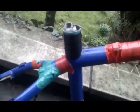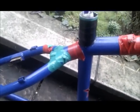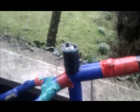You can also see there's quite a lot of tape on the frame — this is where I've plugged up holes. I've been using Blu-Tac and then just some standard electrical tape for holes on the frame, because there are normally holes in the bottom bracket, and you'll also find holes from each tube. As you fill up to the top, you'll get liquid running out, so in the headset there's some Blu-Tac covered with tape to stop it all pouring out.